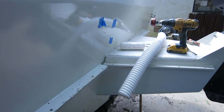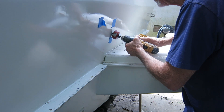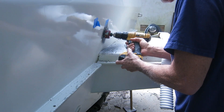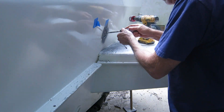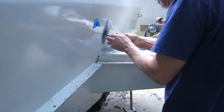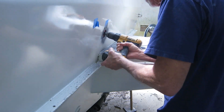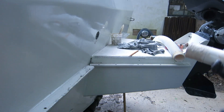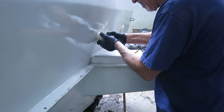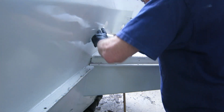Take a deep breath and drill a hole. I double-checked and I think I'm correct. The little hole saw I have that fits best isn't a very good one and doesn't cut very deep at all, so you have to drill a bit, pry out the waste, drill some more, and pry out the waste. But we got through it and the size was very accurate — we end up with a good snug fit. I coated the inside of the hole and the outside of the pipe with some thickened epoxy, got it into place, and just left it alone for a day. It's not coming out — I'd have to drill it out if I ever need to remove it, but I don't anticipate that.